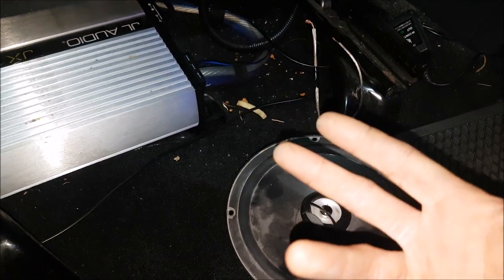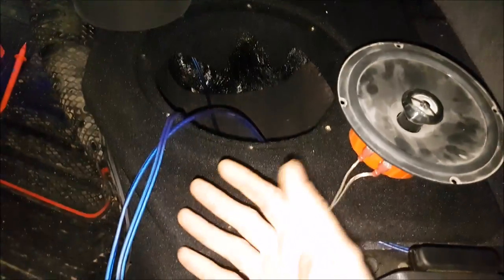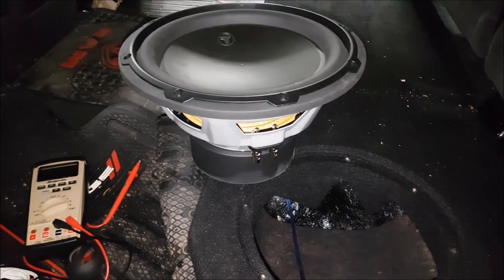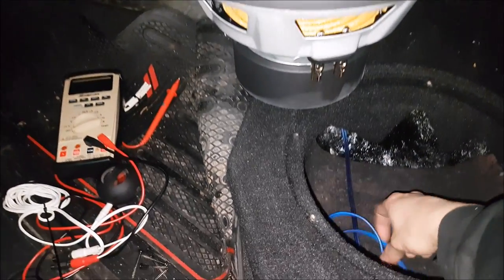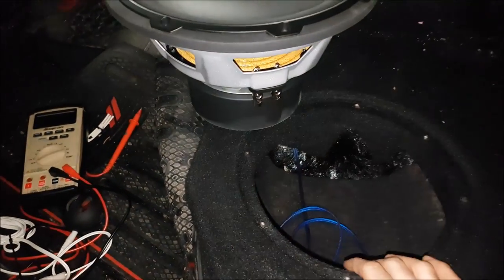I am getting audio out of the amplifier, so we can go ahead and check the enclosure. I now have the enclosure taken apart. I take the speaker leads off of the aftermarket enclosure and put on my test speaker. I am getting activity, so it's looking like the subs are blown. The customer purchased the extended warranty, so we're going to send the subs out for service. Make sure you terminate your ends inside the enclosure so they're not touching each other when not attached to the sub.